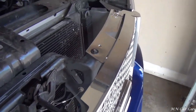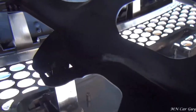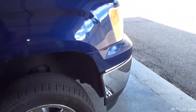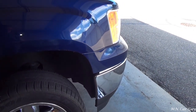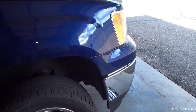The next step: there's four 10-millimeter bolts up top here, so I'm going to take them all out. After that there's several clips that'll need to come undone, and then lastly there are bolts on the inside of this filler piece - it just clips in from there. We'll take that out, and then the whole grill will be removed plus that filler piece, and we'll have good access to the lenses. All right, so this is the hard part.